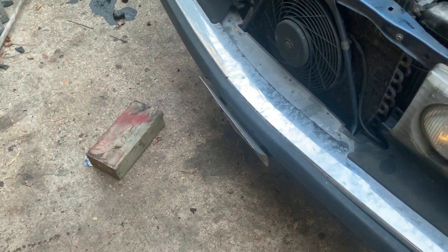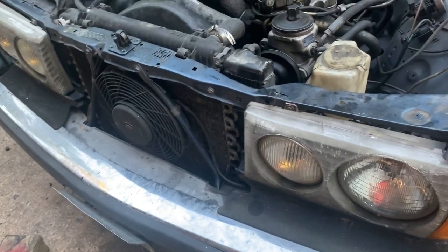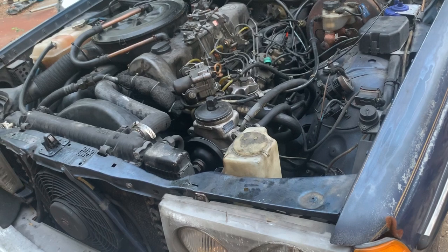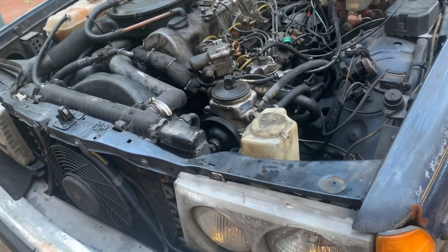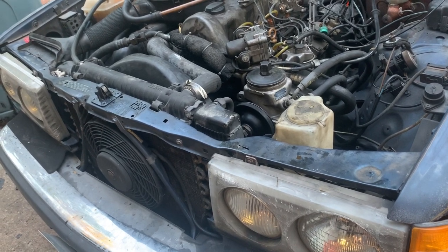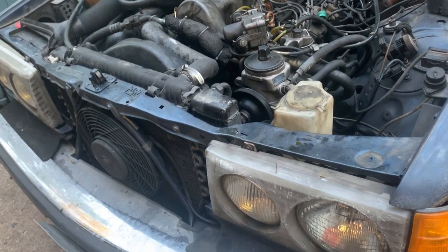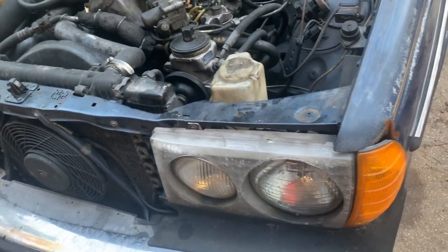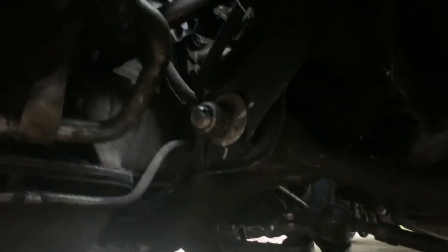So I let it down on two of those blocks so I could have the suspension sitting on those control arm bushings with the bolt just snug but not tight. And then once it was down, I went ahead and torqued those. It's 180 newton meters, which is like 135 foot pounds, is the torque spec on those. And I just did 135 foot pounds, and they are torqued down. You can see them in there, it's starting to get dark right there.